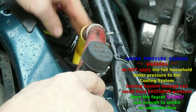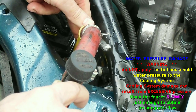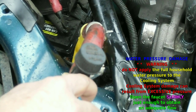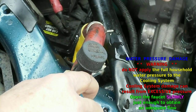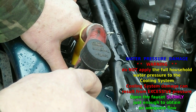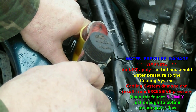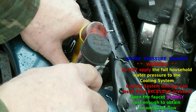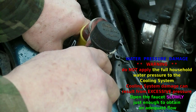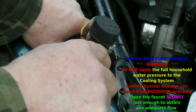So we rigged up the water going into the radiator and rigged up a second hose coming out of here into a large container to get the old antifreeze out of there. We don't want to throw that on the ground — it'll kill pets and livestock and assorted animals, and it'll mess up the environment. So we'll run this until we get a clean flow into the container.